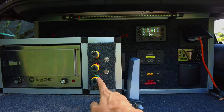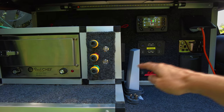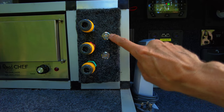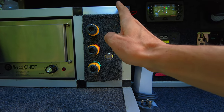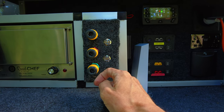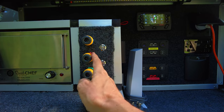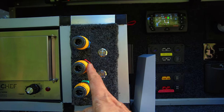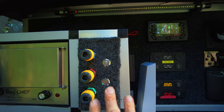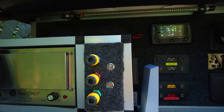Over here is my Egon water hub. The way this is configured: fresh water comes from the 50 litre water tank that was behind the seats; this is hot water, which comes out of my Equios water heater; and this one is external pickup. The two pumps are controlled off these switches — the top one controls fresh and hot water, the bottom one controls input from source-unknown water. If I plug the hose in here, put it into a bucket, and hit this switch, I can run the hot water shower. I've had five showers out of this when I was in Germany and Finland. Works fine.